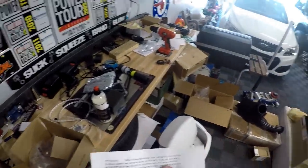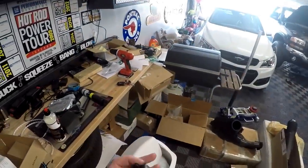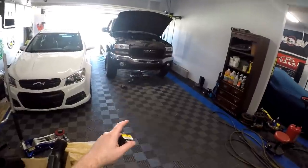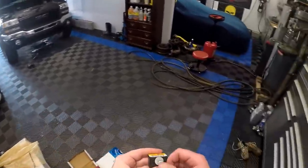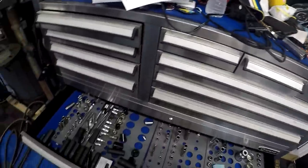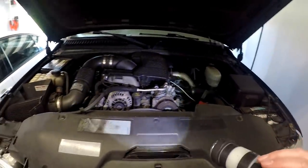The instruction sheet is basically telling you to disconnect the battery and wait a while before installing the sensor, because you don't want the airbags to deploy when you fire the car up. I disconnected both batteries — it's probably been 15 to 20 minutes. I went back inside, took a break, took the skid pan off. I think this bottom skid plate bolt is a 10 millimeter — yep, it's a 10. I disconnected both batteries and it's been about 15 to 20 minutes, so this system shouldn't have any charge in it.